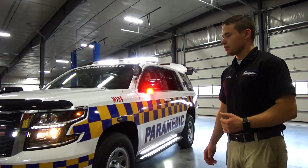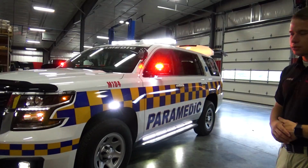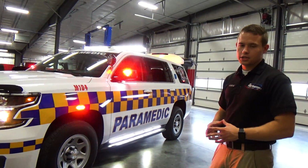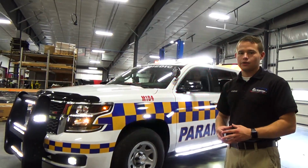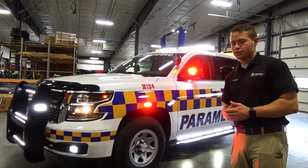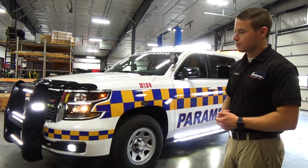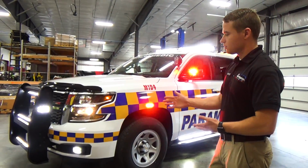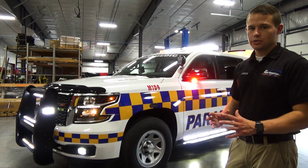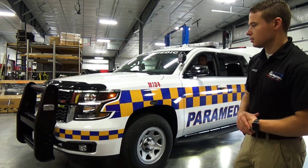As we come around the side of the vehicle here, we did speak a little bit about the CAN port option that is equipped with the Carbide unit. Not only does this have the OBD2 functionality, but the Carbide unit allows you to hook the lights directly to the unit and sync the flash patterns of the entire vehicle through the Carbide itself via computer programming. So the M4s and the functionality you see on the front end and throughout the vehicle is being controlled through the central unit, and every item on the vehicle can be changed simply by plugging a laptop into it.